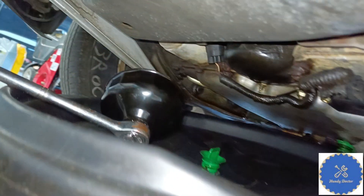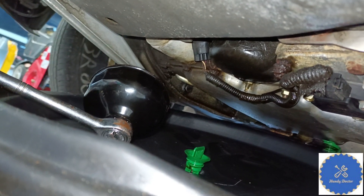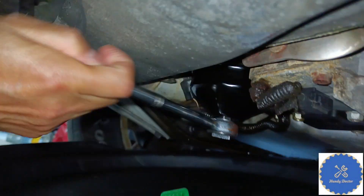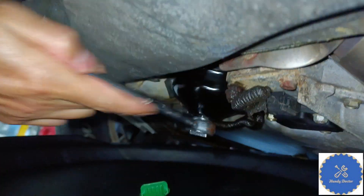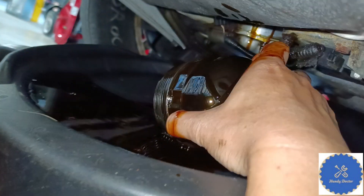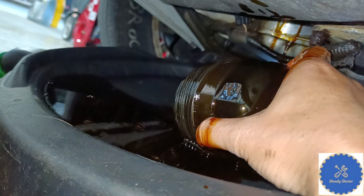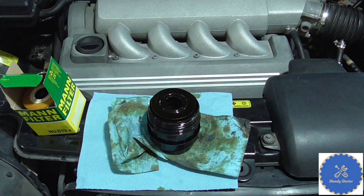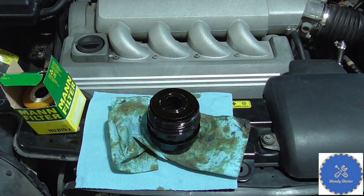Now we just need to remove the oil filter housing. Make sure you have a bucket on the bottom to collect oil, and of course you need a big socket. There is a link in the description to Amazon for that too. Just ratchet it on. I have to say it was very tight to get started — that's why you want to change your oil. There was quite some amount of oil still in there, which explains why I did not extract all of it with the extractor. This further proves you can do it this way — all the oil will come out from the dipstick hole and from the oil filter housing. Make sure next time you have a piece of paper towel ready.